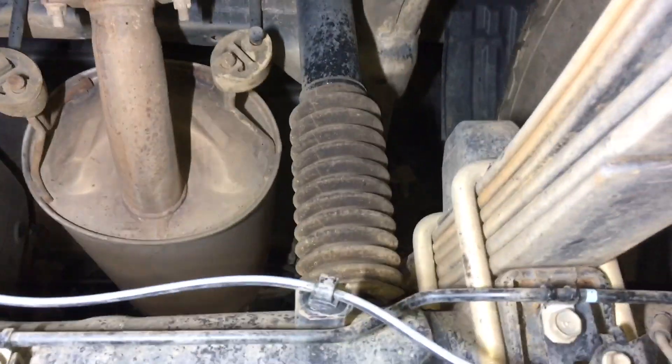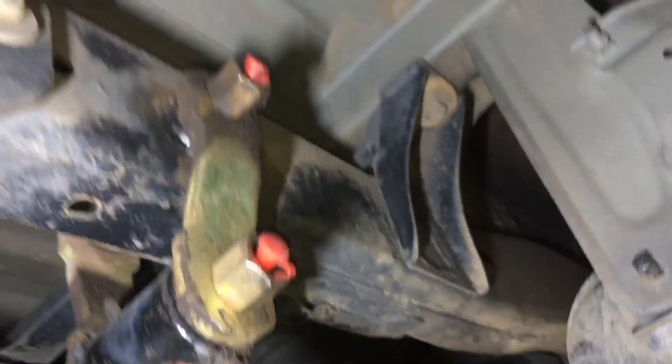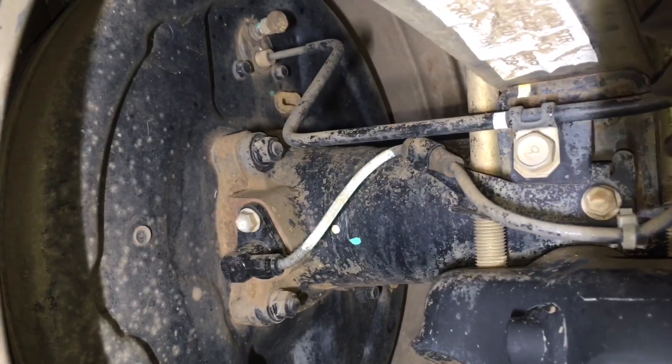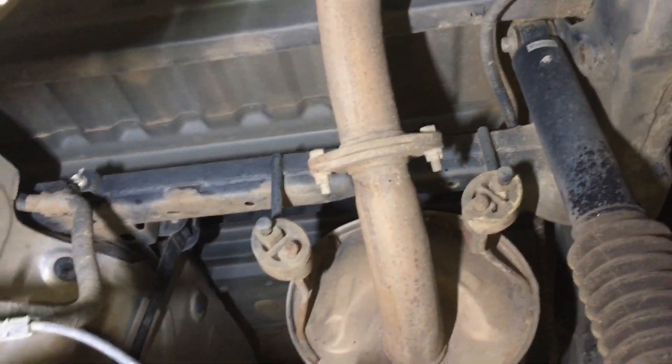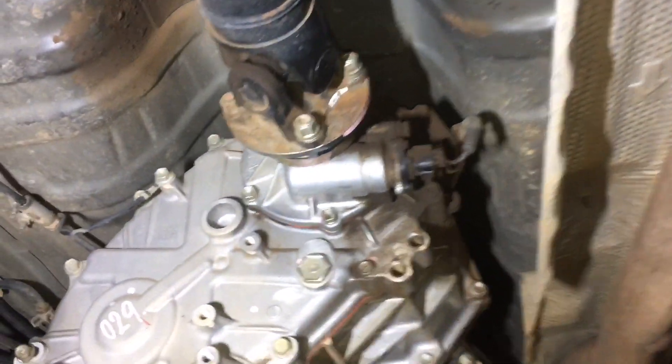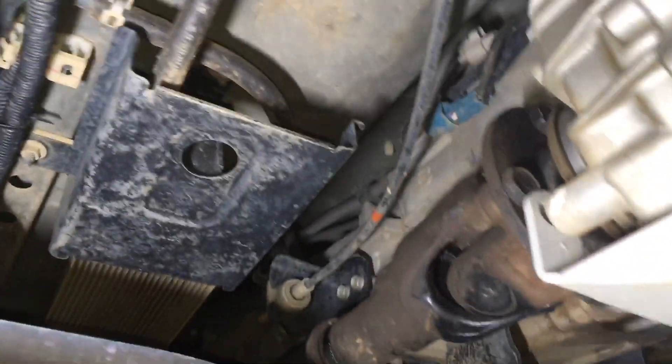We've got the same IMS suspension in the rear, the Dobinson's gear, the brakes are all okay, like-new steel exhaust — everything like the Prados in the rear. It's got the greasable shackle upgrade, spare wheel, tow bar. Nothing exciting. No noise in the bearings, no play in the bearings. On the Hiluxes you've got to watch out because the rear wheel bearings — I don't know if it's because people overload them or they're not as strong — they do fail more than the Prados. The Prados don't really have a problem on the rear. On the Prados it's more the front, but the Hiluxes have a few front bearing issues as well. Not a lot to see under here.